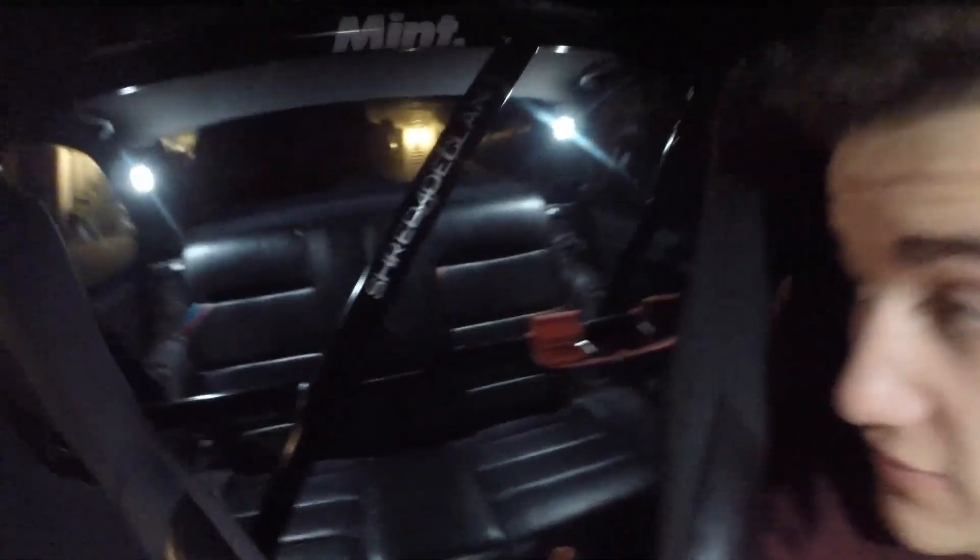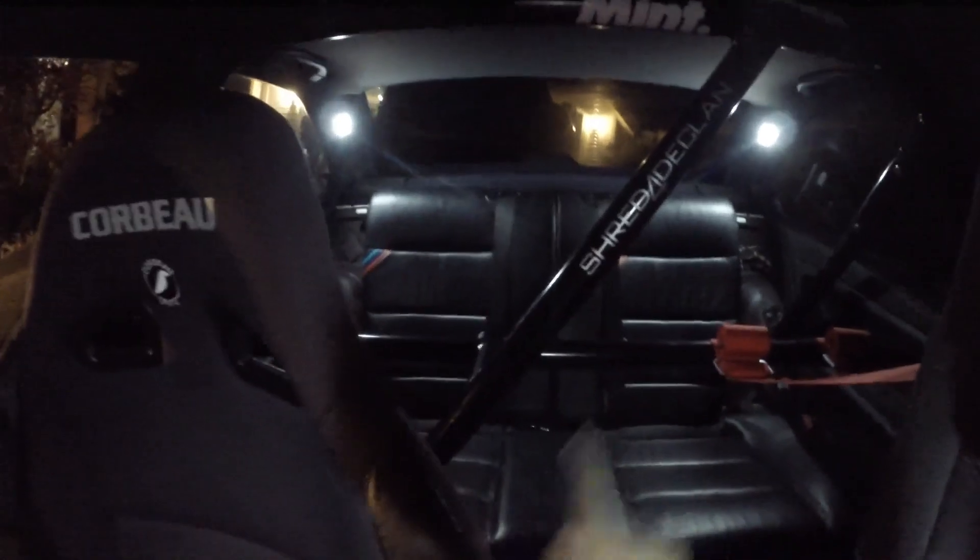For this first round I don't need door bars, so I'm not going to be putting any door bars in the car yet, but I do need fire extinguishers. Right now we're going to go ahead and mount the first fire extinguisher bracket, which we're going to put on the cage right there. It needs to be accessible when you're strapped in. I'm going to put another one right here in front of the seat, and we're going to put the first one on the roll cage on this cross bar.